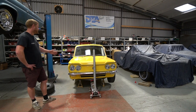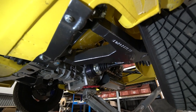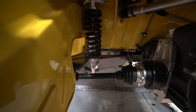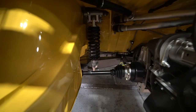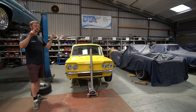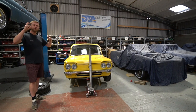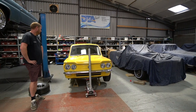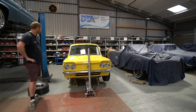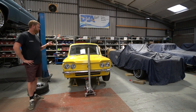We've been through and re-engineered a huge amount of it. The rear suspension arms are completely our own design - adjustable in camber and toe. They also use CV joint drive shafts. Originally these are Rotoflex drive shafts - basically a rubber donut where the drive shafts have a three-legged tripod on the end and the rubber donut takes all the suspension movement. It's just not a pleasing design to have rubber parts like that in a drive shaft constantly flexing as the suspension moves. So we designed our arms to have modern CV joint type hubs.